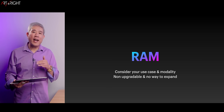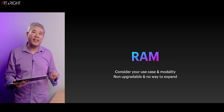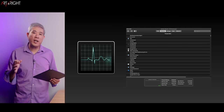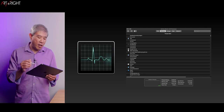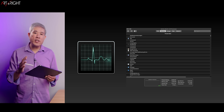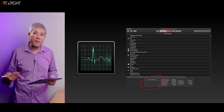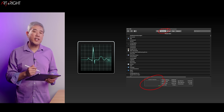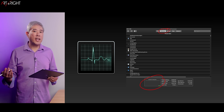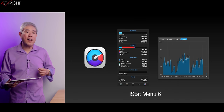When it comes to RAM in the system, remember these are pretty much fixed. Worse than SSD, you cannot expand this — you cannot plug in extra RAM. So you need to consider your options very carefully when you configure the machine, because the only way to upgrade is to buy another machine. The best thing you can do as a current Mac owner is restart your machine, launch Activity Monitor, go into Memory, and take a look at the memory pressure throughout your workday. If it's in the yellow or red, you probably need more. If it's green all the time, you're probably fine.